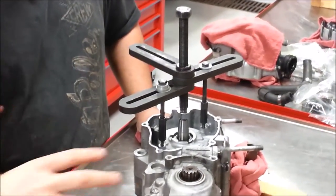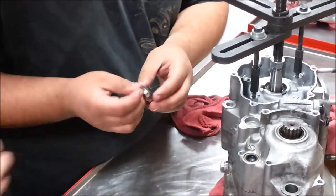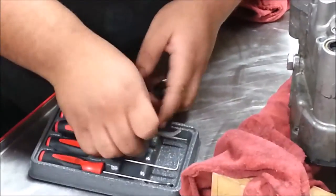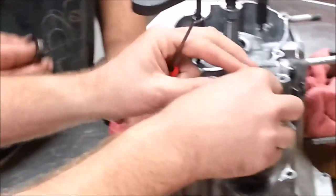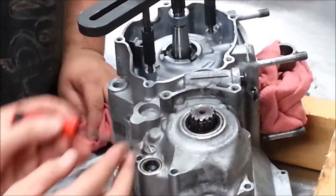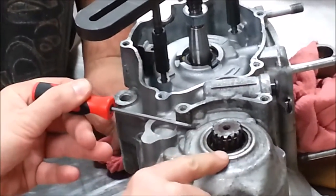There's something else a lot of people get into trouble on — George, you've already got it taken off. We got this part out — it's just the spacer for the sprocket. And there's an O-ring in there that we take out with this little pick right here. You have to go in and push it — you can kind of walk it out. You need to point it into the groove, because if we had it out, we'd ruin the oil seal.